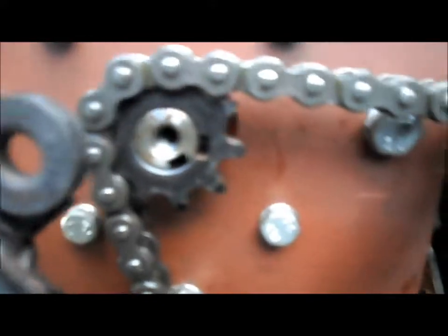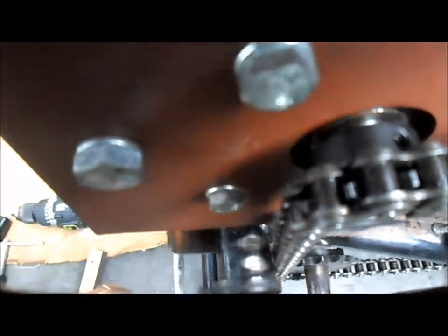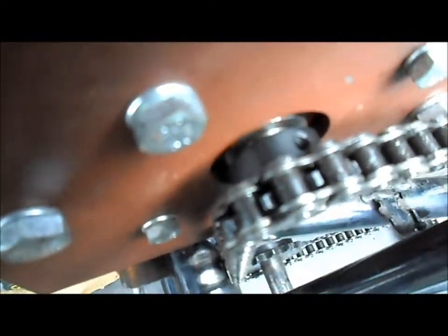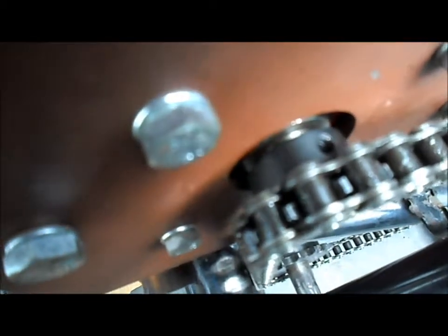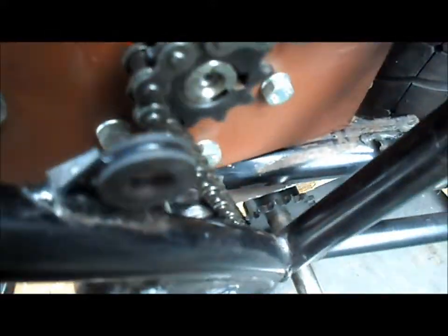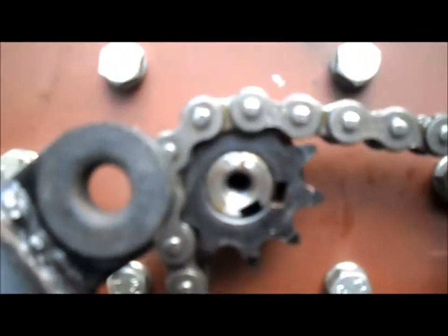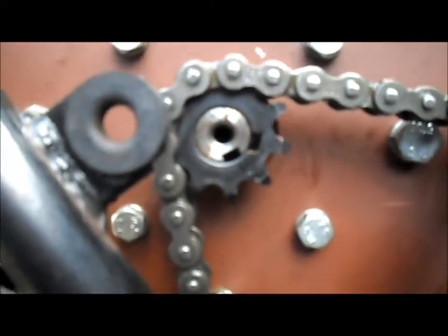The only thing is I think we're going to have to get another 10-tooth sprocket like this one for the jack shaft. I have the 15-tooth sprocket on it right now and the chain barely clears — any slop whatsoever and it's going to be rubbing on that trailing arm bar. Going from a 15-tooth sprocket down to a 10-tooth sprocket should change things dramatically.